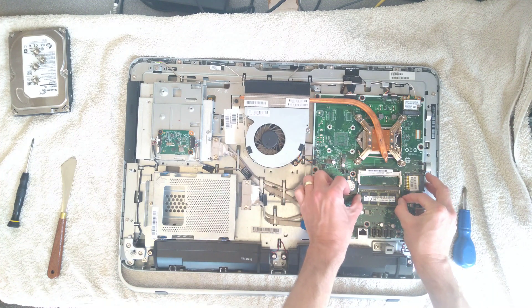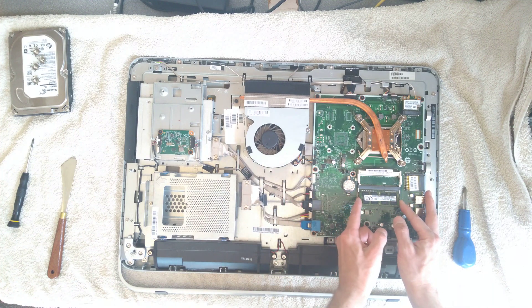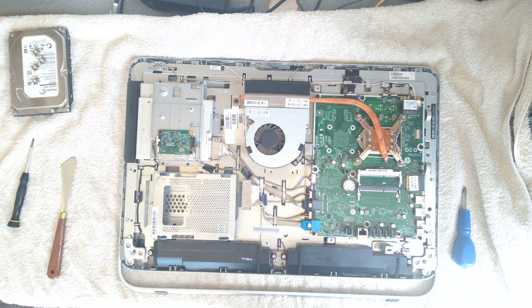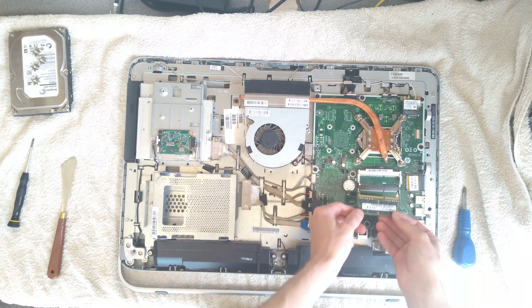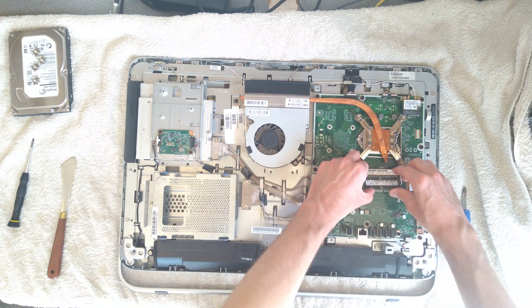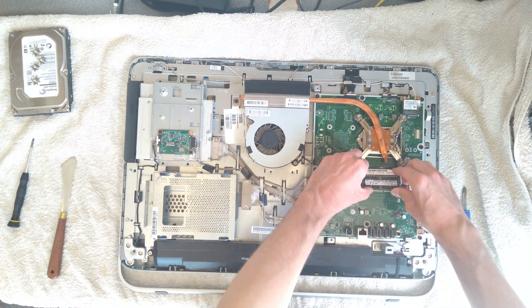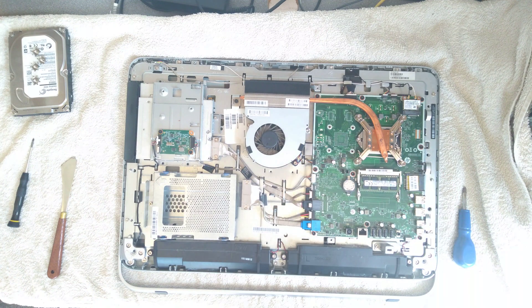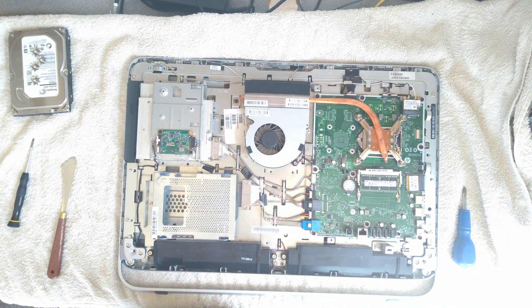Because of the weird fault with this machine as well — even though I didn't find any memory errors — I will clean and then put back the memory in a different slot, just in case it's some kind of weird memory problem that MemTest 86 didn't pick up.